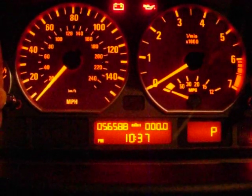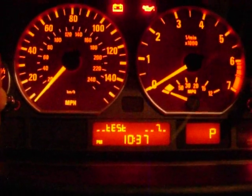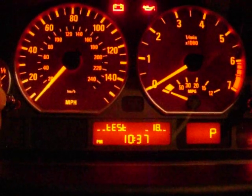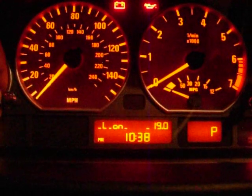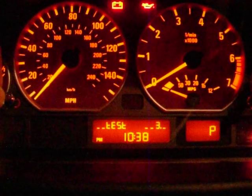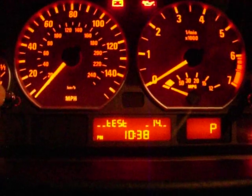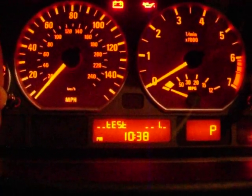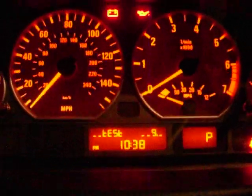I think I messed it up — let's do it again. Go into 19, and that says 'off'. You're going to wait, and then you can go into your test once that's off. The battery voltage is test 9. If you accidentally skip past it, you can go down to 20 and it starts over at 1. So let's go into 9 and see what we have.